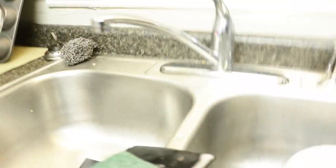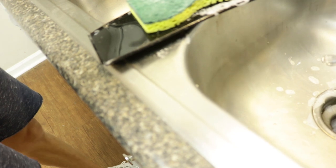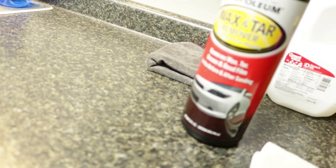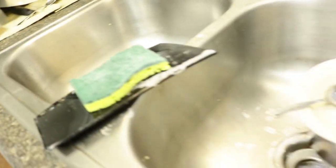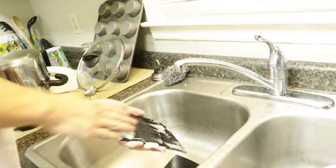What we're doing first is wiping down and washing these panels with ammonia-based soap — pretty much your regular dish soap. The reason we have to do that beforehand is to get the best adhesion from the wrap. Second, we're going to use a wax and tar remover, which will enhance the adhesive to stick even better. Me and Noah are going to clean these off with soap and water and get back to the wrapping process.